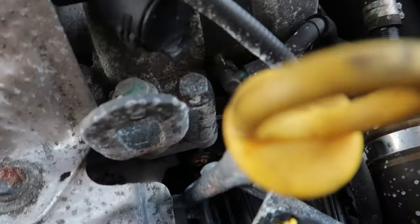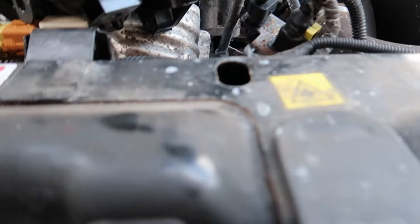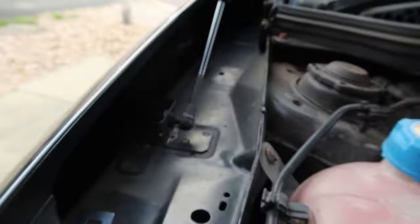You can see where all this white residue is — that's where it's leaking from, all down the bottom there, absolutely covered the manifold. I've got the brand new replacement here. Now, from the research I've done, you don't have to drain the whole coolant, but let me explain. You can see in the coolant expansion tank it looks quite gunky — and if I take the lid off, you can see it really is. That's because the previous owners knew there was a coolant leak but not where it was coming from, so they put rad sealer in there. The coolant is absolutely filthy. So the first thing we're going to do is get the car in the air, get the bottom hose off the radiator, drain all the coolant, and I've got brand new fresh Millers coolant with distilled water to go back in.